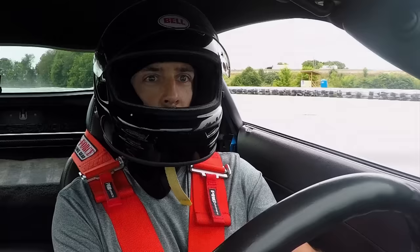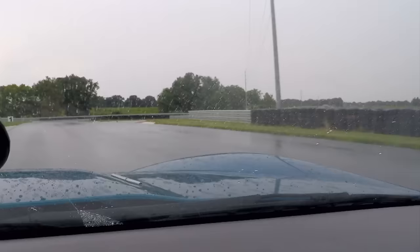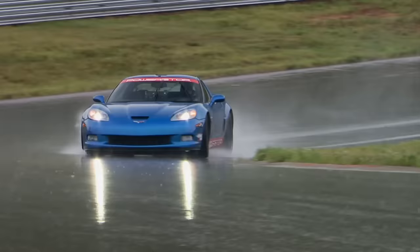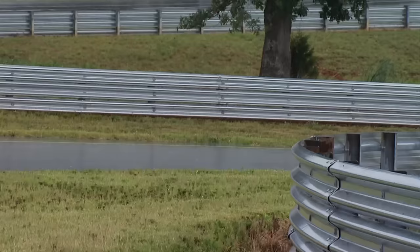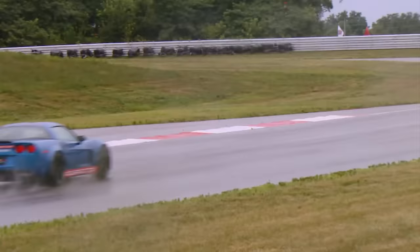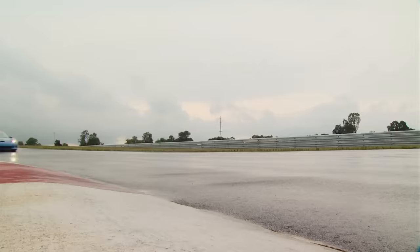Today is going to get a little tricky — another new addition: it's starting to rain. But we're continuing on. There are a few things that need to be adjusted, the most important being our driving style. It's going to take some finesse on the wheel and throttle control — this thing makes over 520 pound-feet of torque at 2,500 RPM. It's going to take a few laps to find out how the car really handles. Right off the bat, these Continental DWs are up to the task — they hold tight in the corners and under hard braking. I'm already impressed at this Z06 upgrade: the trans is tight with solid shifts, and the Edelbrock supercharger has very quick response and great power whenever asked for.